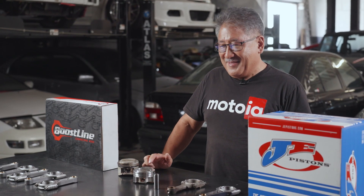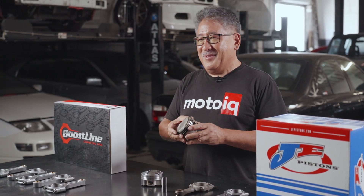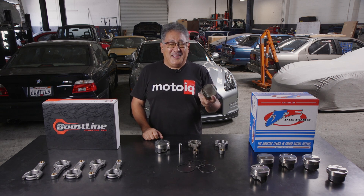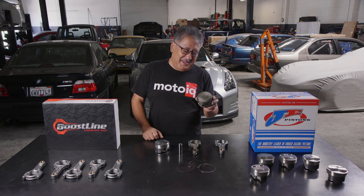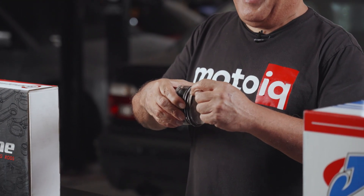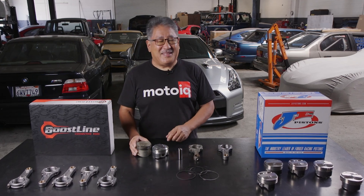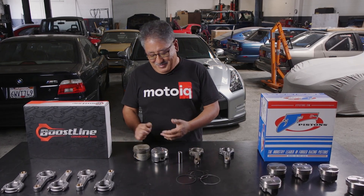In our upgrade path the next thing to do is to look at pistons. The weak point of the stock motor is the stock cast piston. It's a hypereutectic cast piston — really good for being quiet and for long life, but it's not too good for large amounts of boost. As you can see the stock piston isn't too bad; it has a lot of space for the top ring groove. It's one of the reasons why these RBs are pretty decent stock, but anytime you surpass like the low 400s they become iffy.